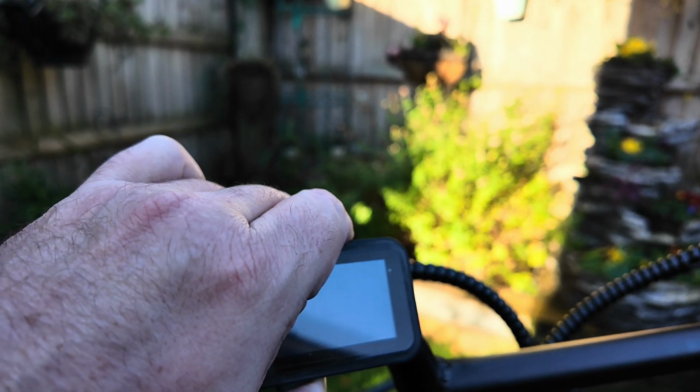Let's turn it off. Well, that concludes my review of the LE20 Boost. And I have to say I was quite blown away. Anyway, let's get the cons out of the way first, which I'll do quite quickly. The brakes are dreadful. They work with this because it's a light bike, but these shouldn't be on these sort of bikes. They want swapping out for hydraulics, and that'll cost you about 50 quid. And it's only around a 20-30 minute job to swap them out because the access to the controls is so easy.